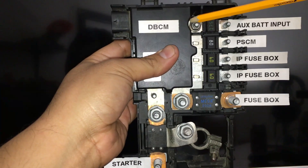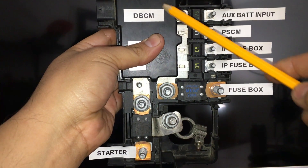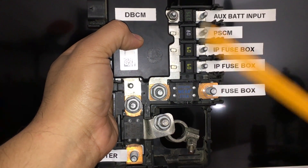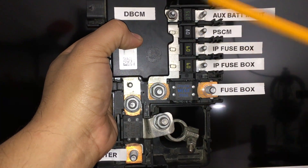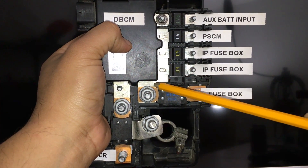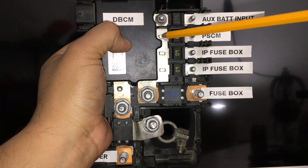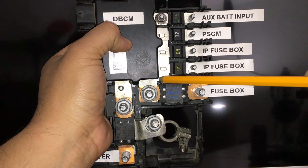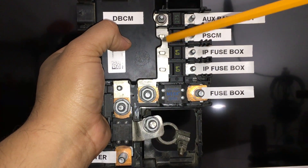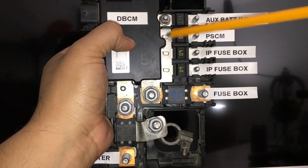To reiterate: two positive battery feeds — the one from the primary battery comes in through here, and the one from the auxiliary battery goes in through here. The purpose of the dual battery control module is to switch between these two battery power feeds, deciding which one is going to handle the load for the interior accessories and powertrain management accessories. This metal pad here — with this metal strip that goes across and down — is going to be our accessory load.